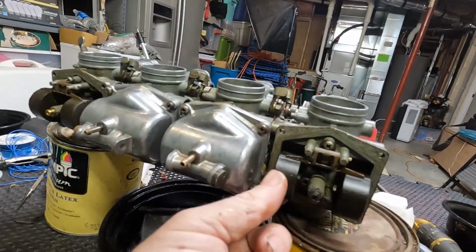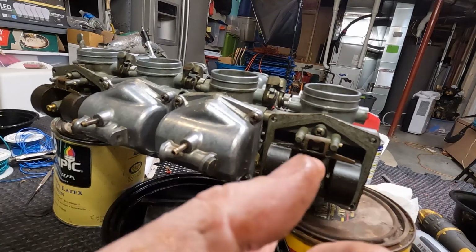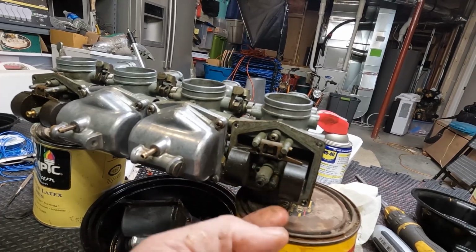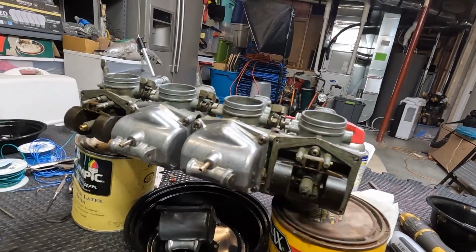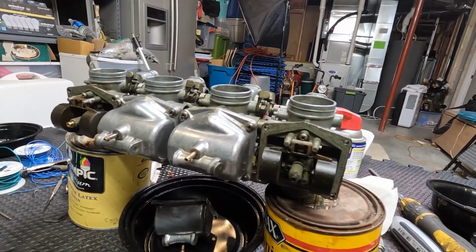carburetor. I'm gonna clean it up, spray it down. This screw holds on the float housing. Float's in there. I gotta figure out why this float's not moving. Take this brass piece out, unscrew the other jet here. This will screw up. Clean it all up, spray some gunk in there, make sure things are working. So take a look at it now, and then I'll show you after I put the new pieces in.